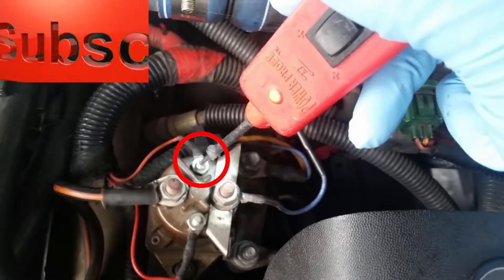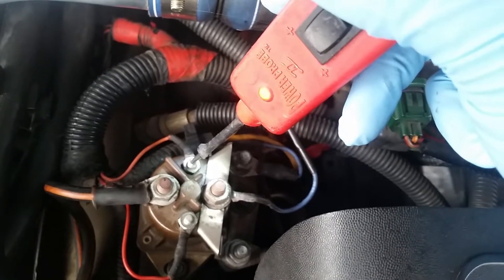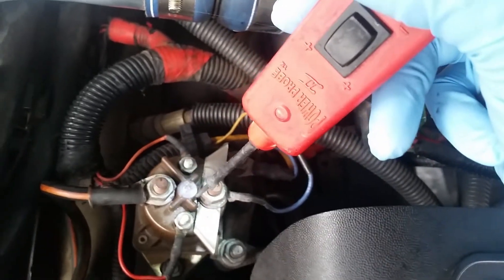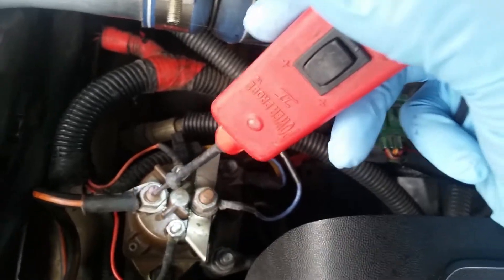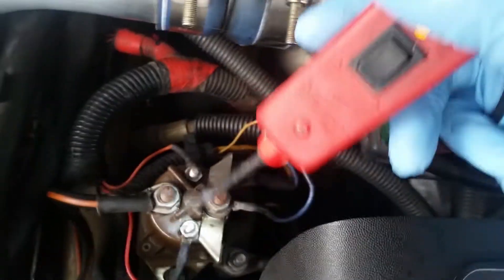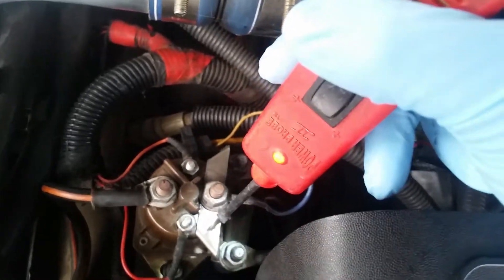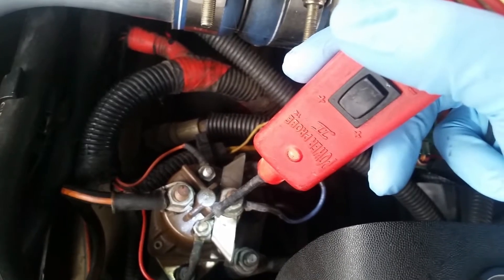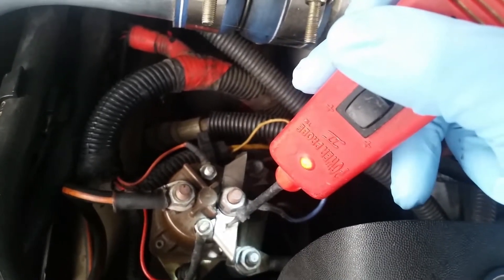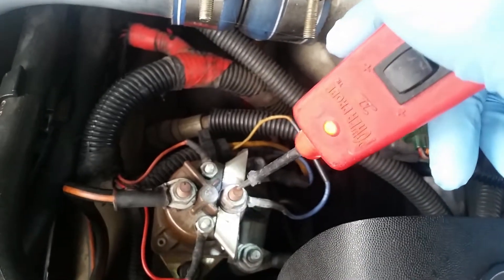This is a communication wire for the computer. Put it in the on position again — and nothing coming out. So power, power from ignition. This should be power to warm up your glow plugs, but it's grounded still.